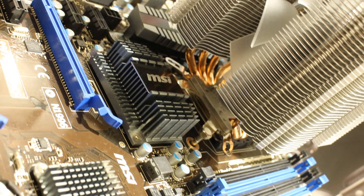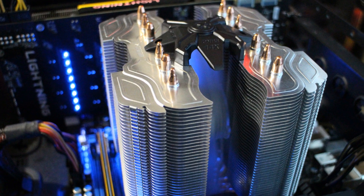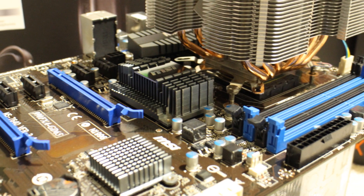For the AMD specifically, we used the FX8320 on an MSI 990FXA GD65 motherboard. For the cooler, we used a Zalman CNPS 14X, which is a huge cooler and managed to do a fine job cooling the FX8320 at 4.4GHz. We had the speed set to 4.4GHz at 1.43 volts, the CPU north bridge voltage set to 1.25 volts, and the north bridge voltage itself set to 1.15 volts. The HT transport speed base was left at 200MHz, the HT speed was set to a multiplier of 12 giving 2400MHz, and the HTT link speed was set to 2600MHz — the sweet spot at 4.4.